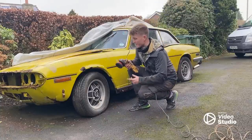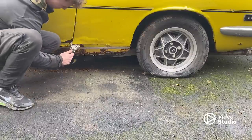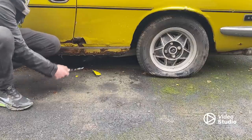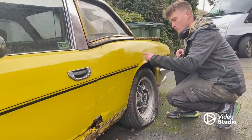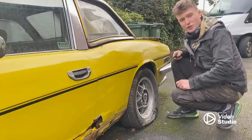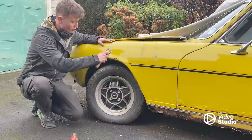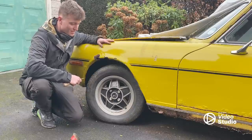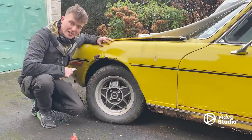Welcome to Boozmotors. Today I'm taking an angle grinder to the paintwork to get all this filler off and see what's lurking underneath. I want to see if the rust doesn't go too far up, because then I'll be able to use repair panels rather than full panels. That would cost around £1,400 versus two and a half grand, so hopefully there's not too much rust and we can save that money for suspension repairs and other bits.